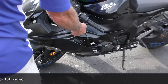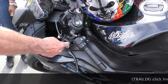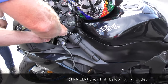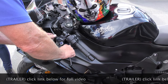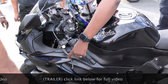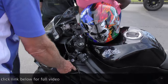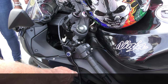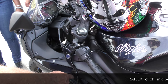There's nothing, right? So if you keep it there, when the clutch gets hot there's no expansion room. We've got to be able to screw that in so that we get free play here. Push this back with your finger gently — feel it? You've got nothing. We only want a couple of millimetres here. So then we pull this back a little bit. It's a little bit too much. That's better.